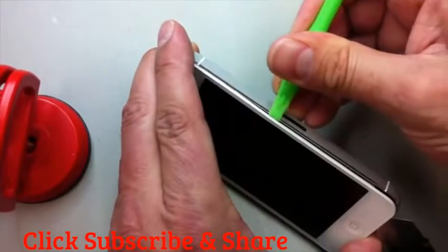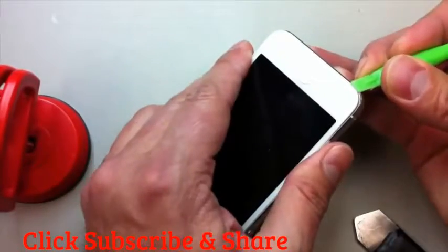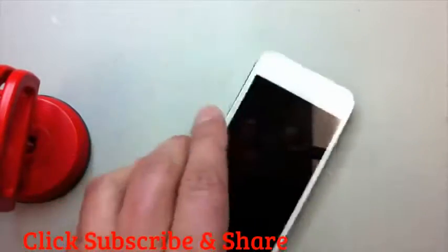Make sure you're getting underneath the entire plastic frame in between the metal housing and the LCD frame. Otherwise, that will actually split right between the glass and the plastic that goes around the outside. So what we'll do is work our way up both sides of the phone here, just very carefully. And again, don't pull too hard.